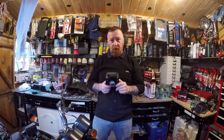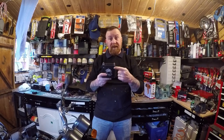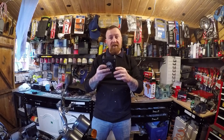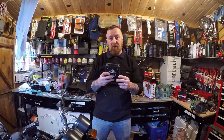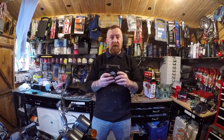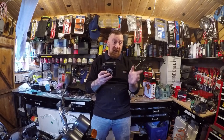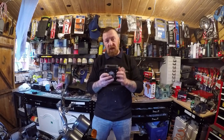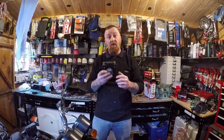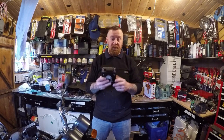My top tip for the day: if you're not going to use your motorcycle or moped for a long time, take off the power lead off the battery — that's the positive, the red one. Take it off, move it away. Leaving it earthed is fine, but taking that power off means the battery will stay where it is — it won't have any drain on it whatsoever. It will keep a little bit of charge in there, charge back up, and away you go again. Otherwise, keep them topped up and start your bike regularly — even if you're not going to use it much, start it every fortnight or so, let it tick over and run.